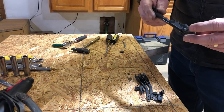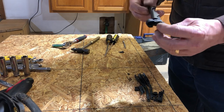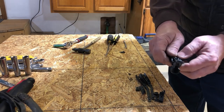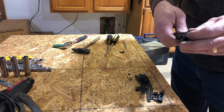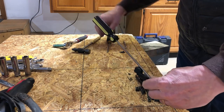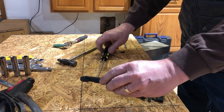Many of these headlight wiper assemblies break here where it mounts to the post, and sometimes they get broken here, as you can see. So I'm going to take this one apart and replace this cover. It's pretty simple — there's two tabs. This one doesn't have the second one because it's kind of brittle. And then there's this holding clip. I usually just take a screwdriver and hold it with my thumb, and just tap it towards where it mounts, towards that mounting screw.